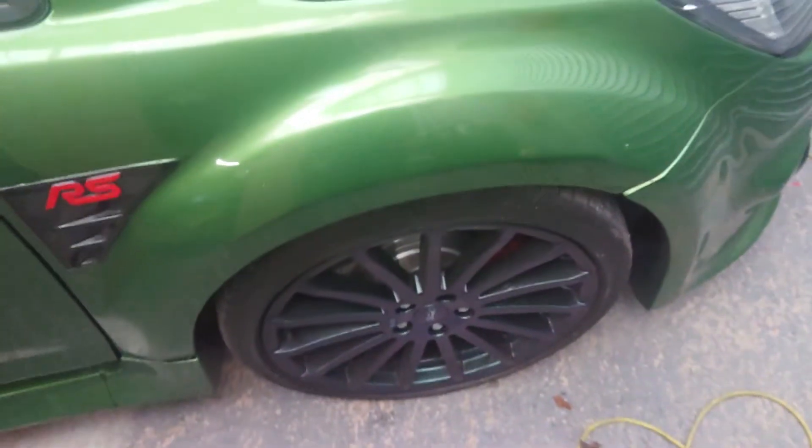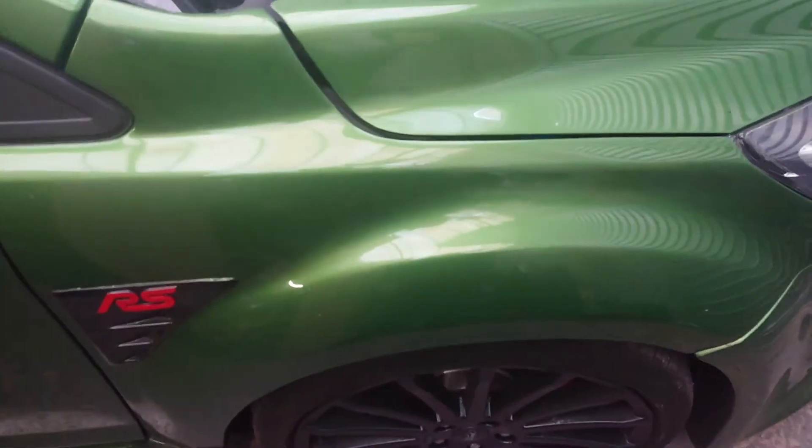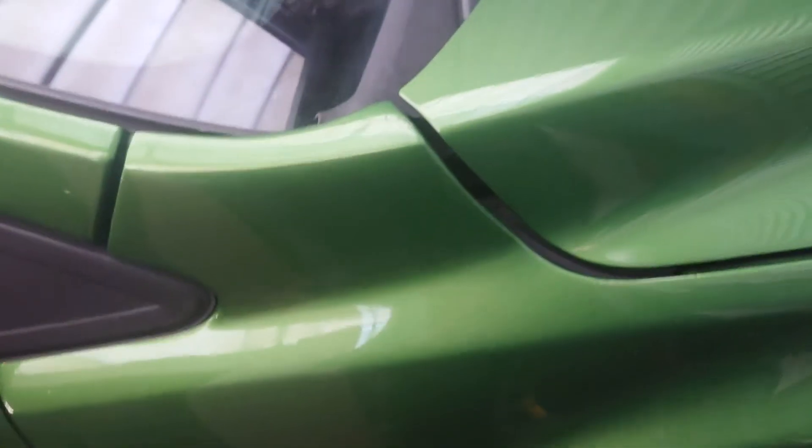This was originally an ST as well, so basically we could either copy this hinge, which is cracking, or we could just take a mould of this area here, and then try and create something out of fibreglass to then put over to the other car. First job is to cover this so that it doesn't get damaged. I'm going to use some black tape because that seems to peel off quite well without leaving any residue, and then we can put some plastic down to cover that, wrap it around here so it keeps it tight, and then we can look at putting some fibreglass on there.